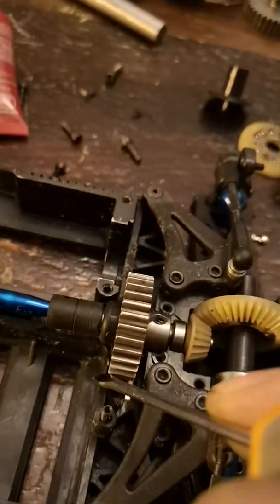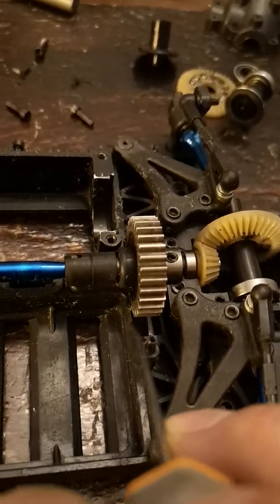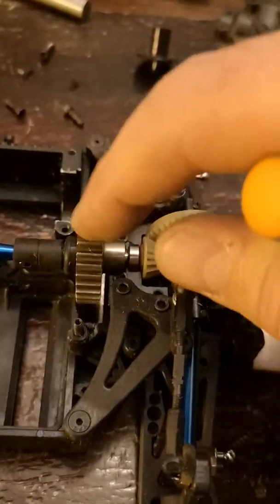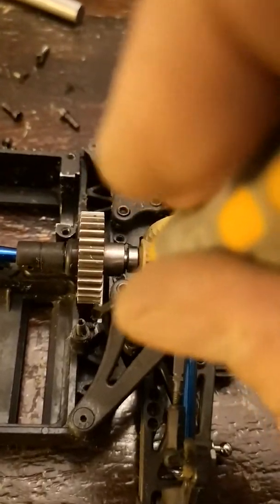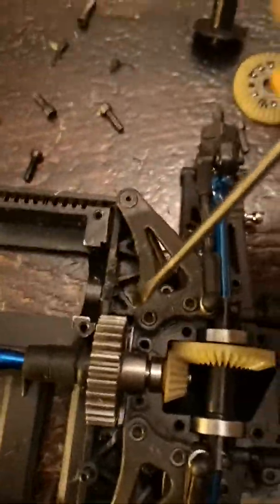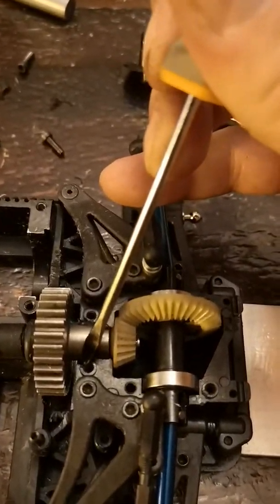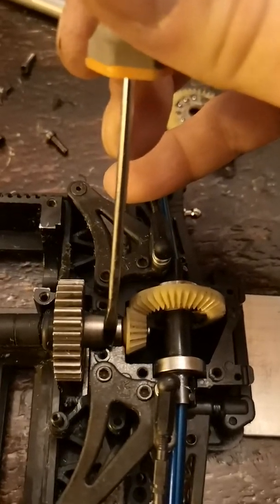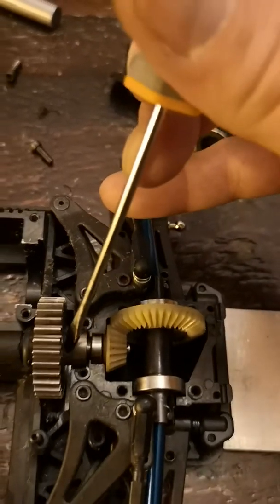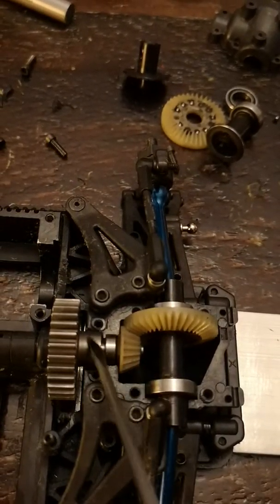On the shaft you want to make sure that this fits in between these holes. When you have this all out, you're going to take the Dremel and shave this square hole just a little bit on either side — you don't want to go too much. You want to make sure that this can sit inside that space. I shaved a little bit off straight across so that this fit in there, and then I shaved some of the diff case on this side, straight on this side and a little bit in here, just so that this will fit in there.